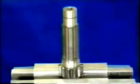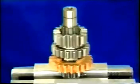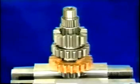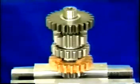To start with the assembly, first complete the main shaft: fourth gear pinion, shim, circlip, fourth and fifth gear sliding pinion, spacer, 24 bearing needles, fifth gear pinion, spacer, circlip.